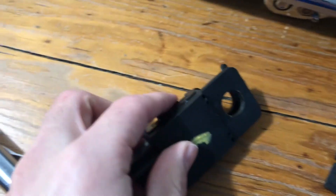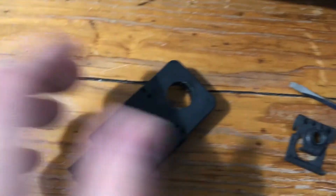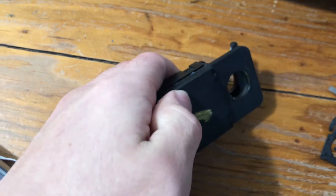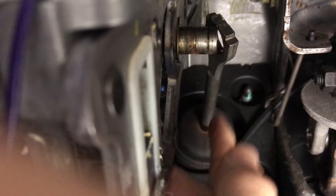The hook side goes towards the driver side. The brake pedal rod has a pin and it goes through the switch along with the brake pedal, so you have to slide that out and then it'll hook down. There's the rod and here's the brake pedal pin — the switch just goes right in between there.